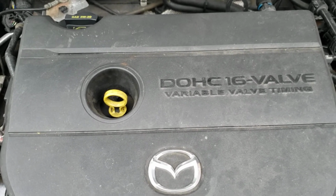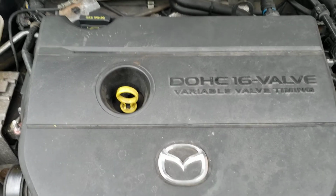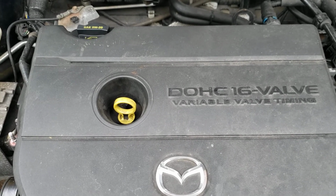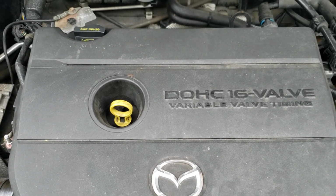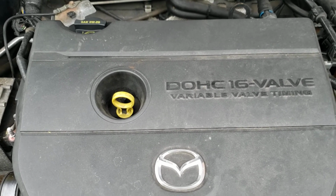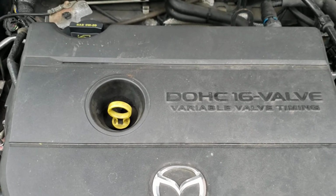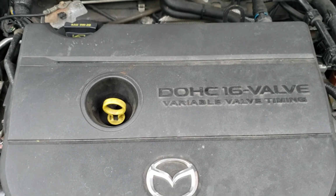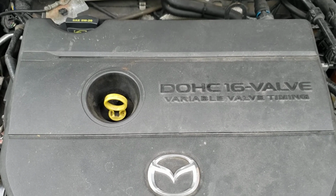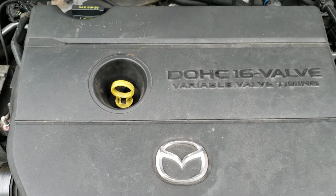After that happens, you no longer have good oil pressure. And in addition to no longer having good oil pressure, anytime you run it any bit low after that point without the proper oil pressure, the engine's done. You may as well just pull it out and use it as a boat anchor, because once you spin a bearing or wear the bearings on one of these engines, in order to tear it apart, you may as well just buy a salvage engine, which is what I did in this case, or you may as well get a crate engine, I guess, if you want to pay that much.